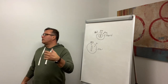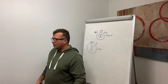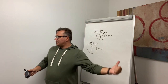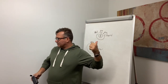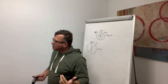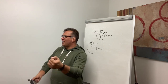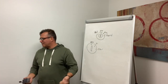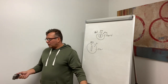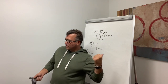Engine goes, then you see the ABS light coming on and going off if your system is working properly. So you've got two lights, one ABS light on the cluster, another ABS light on the side of the trailer, in the very back. If something is wrong with the ABS system, in most cases, guys, it's just a dirty sensor. You were driving in the mud or picking up in some rural area. Or in some cases, maybe it's a broken wire. It will stay on. If on the dash you have the ABS light, the light in the back duplicates it.